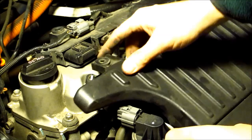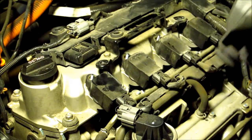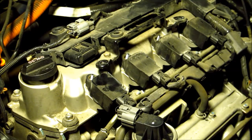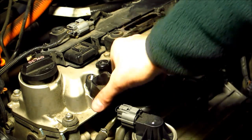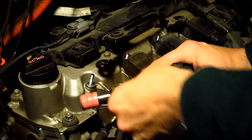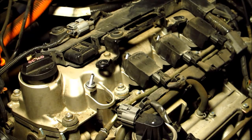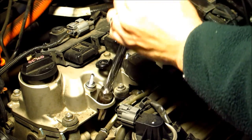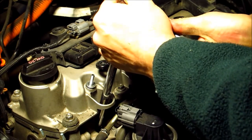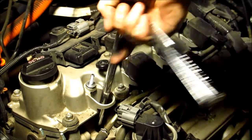To do the front bank, get these bolts off, and then this thing just sort of pulls out — just yank it out — and then you have a lot of clearance. You can get all those 10 millimeter bolts, and then these ones pull out, and you get good access into each plug.